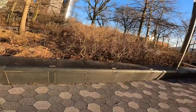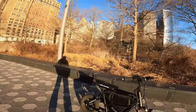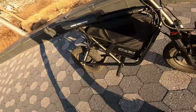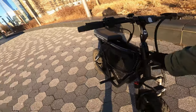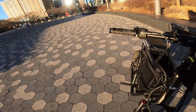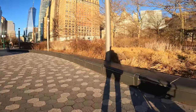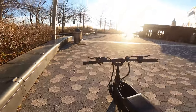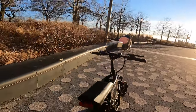For those of you who have never seen the Roadrunner, this is the stock setup. Besides upgrading the motors to 4,500 watts up front and 5,000 watts in the back, I'm also going to be upgrading the front suspension to an inverted fork — it's actually meant for the Fighter but I'm going to use it on the Roadrunner. I'm definitely going to be upgrading the seat too; it's kind of hard as a brick, so I'll probably be looking at JB Seats in California for a custom seat.